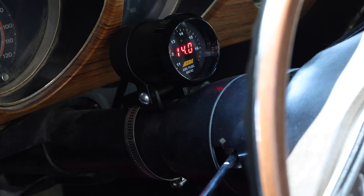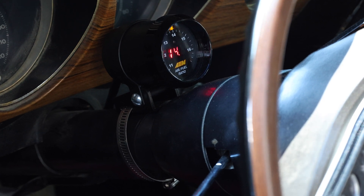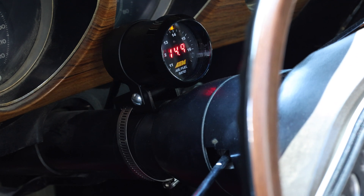After this is done and I have the highest vacuum, I'm going to go ahead and check my air to fuel gauge and make sure I'm reading in the right area that I want to be for idle, which is around thirteen and a half to fourteen and a half to one.